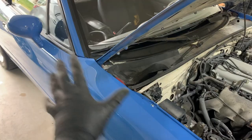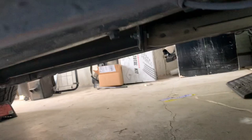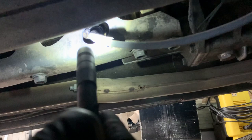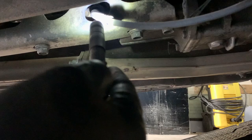I've got the car on ramps. Crawling underneath on the passenger side — you have your power plant frame right here and the speedometer cable right here. You can see it snakes in and ties into the transmission — that's that threaded hose-adapter looking fitting I was showing you earlier. It's a series of clips that go up along the side of the transmission tunnel frame rail and up into the engine bay. Basically all you gotta do is unscrew it from the transmission, undo the clips, and it should pull out from the top.